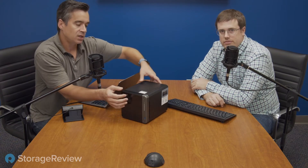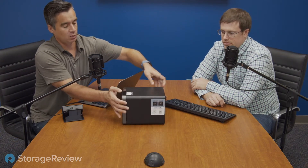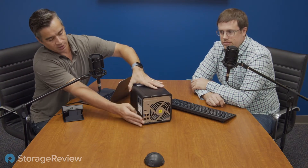They're getting faster, and people want faster file transfers to and from their NAS platforms. We're seeing QNAP — this is the TS-453D that we're reviewing — and you can't really tell visually, but on the back side there are a couple of what look like regular Ethernet ports, and instead of 1 gig, they're 2.5 gig.